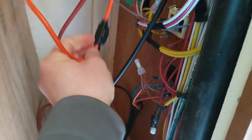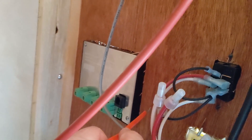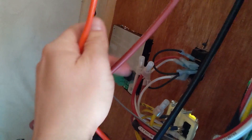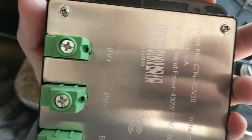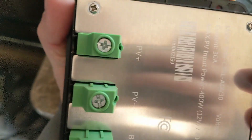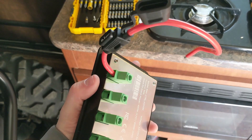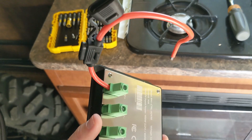This is one of two inline fuses I'm going to be using. This end is going to connect into the solar controller, and the other end will be connected to a switch on this wall. The reason I'm connecting them here is because if I need to replace this fuse it should be pretty easy to just unscrew this panel from the front and access that fuse without having to take off the interior panel again. To make these connections it's really simple — you unscrew the PV terminals, the wire sits in there, and you screw it down tight. Then I'm going to repeat the same process for the battery positive on the second terminal with an identical fuse.